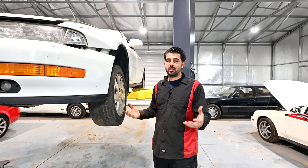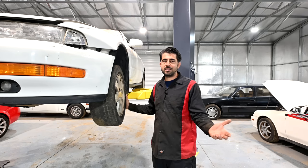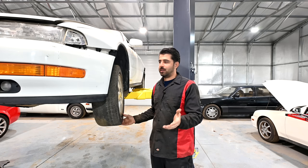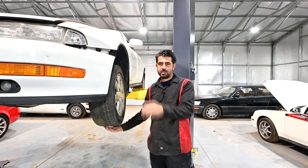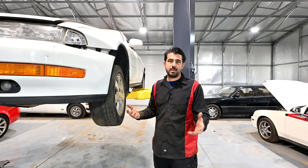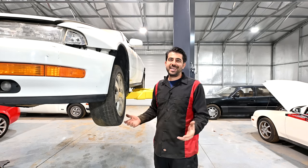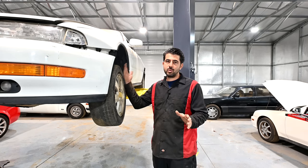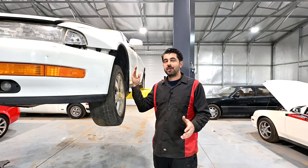So it's best to have a little bit of negative camber where the wheels are tilted inwards, so when you go around corners you get closer to zero degrees of camber and get as close as possible to the most contact surface between the tire and the ground. There's a balancing act here — this depends on your vehicle type, whether it's a performance vehicle, a track vehicle, or just a daily driver like a Ford Fiesta. Too much negative camber means you're driving on the inside of the tire in a straight line and will wear it out quickly. But if you're modifying a car for track use, you'll want much more negative camber.